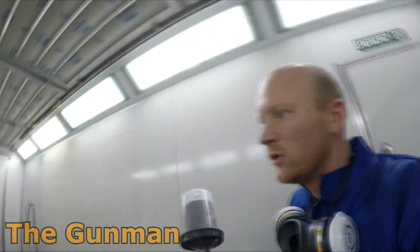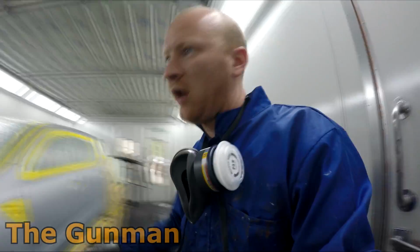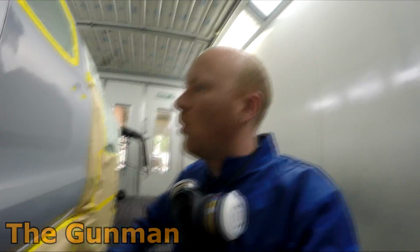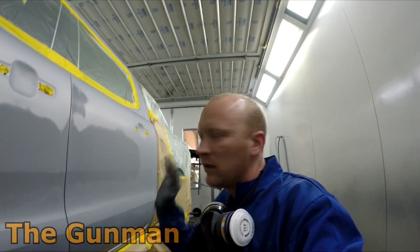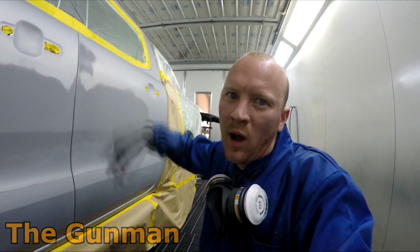I personally don't like to do it on the bodies of cars. If I was going to, say, paint this job and put some non-sanding or value shaded primer down, that primer is going to be coming inside that edge, and then there's no guarantee that your paint's going to follow it. Whereas if I just put colour over there, the colour's going to go in there, the clear's going to go in there, and you're not going to get that primer edge in there.